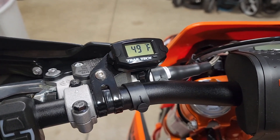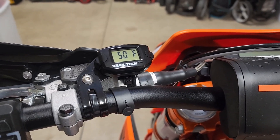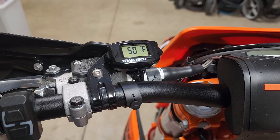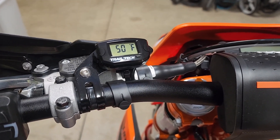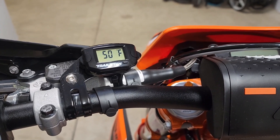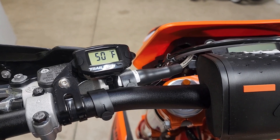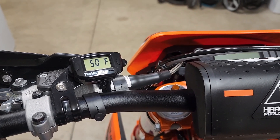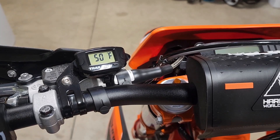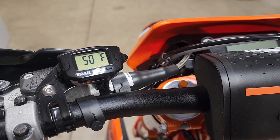I think it works fine for this purpose. I acknowledge there are more accurate ways of measuring this, but most of us just need to know if we're getting hot. If you are, you need to get a fan — I highly recommend one for trail riding. An engine builder I listened to said the main reasons for engine failure are not changing oil enough, poor fuel, and overheating. If your engine gets hot, cam lobes get de-surfaced, engine metal gets weakened, and your motor can implode. So if you're going to put one gauge on your bike, monitor your temperature. Thanks for tuning in — feel free to like and subscribe. We have more projects coming on the 350 and 300. Have a great day.